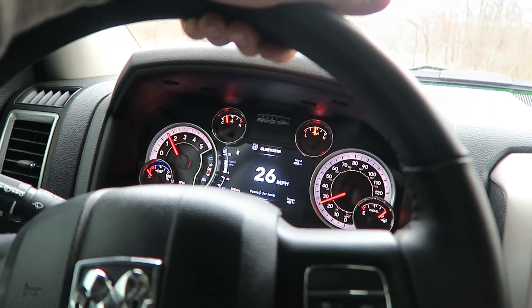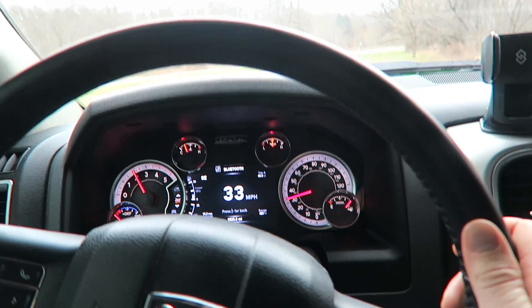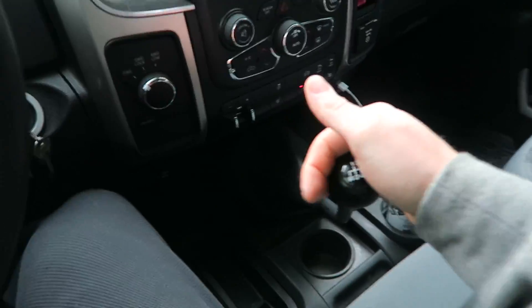Normal downshift. And we'll do it again — give it some speed. There it is, clutchless shift. So, do I recommend doing this? No. Because the first time I tried it, I ground gears in my Jetta. That's why the clutch is there. When you're shifting without the clutch, you're waiting for the gate to open. You and the synchros line up and you pull — you're pretty much pulling against the gate until it opens and it just falls into gear. Go for it and try it out, but I don't recommend it because you will probably grind gears.